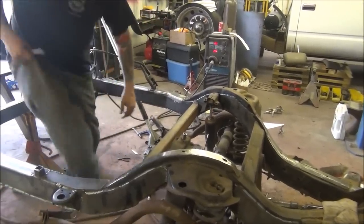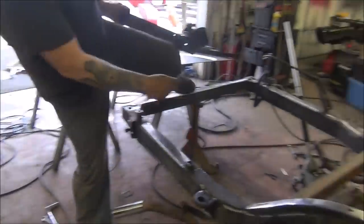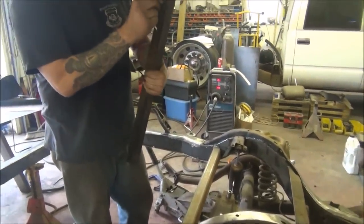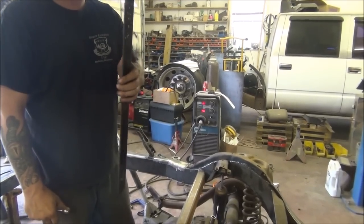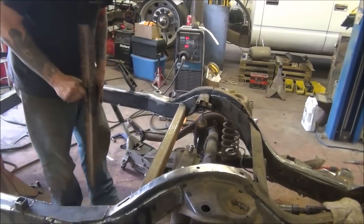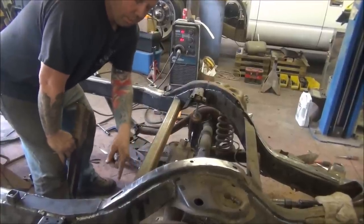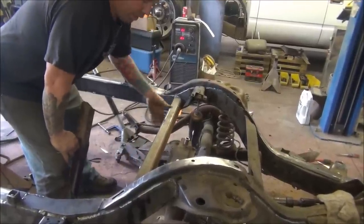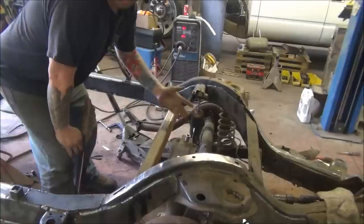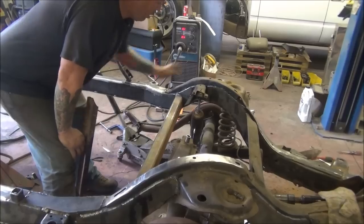Chevy had a smaller piece of metal that connected the frame rails — they didn't really do much else besides that. There was nothing connected to it. As you can see, this is maybe a sixteenth to an eighth of an inch piece of steel. We cut this thing out because it did absolutely nothing, and we took this massive behemoth bar right here and welded it on top of the plate steel that we had already done. This thing is going to provide significant reinforcement when we go to do three-wheel and side-to-side and things like that.